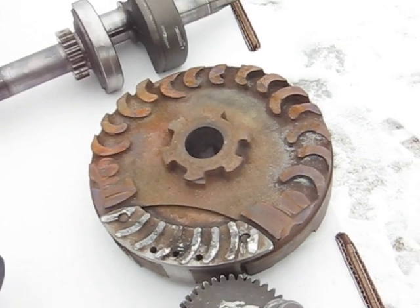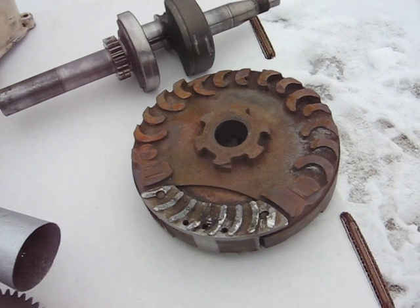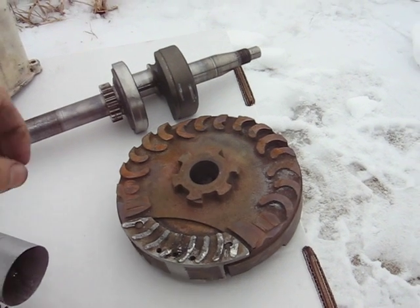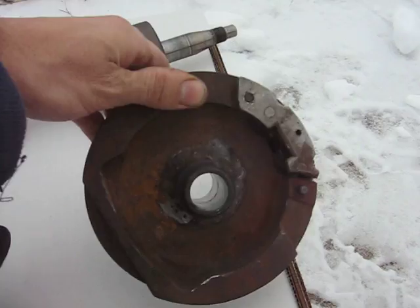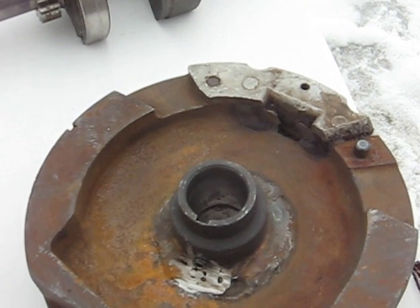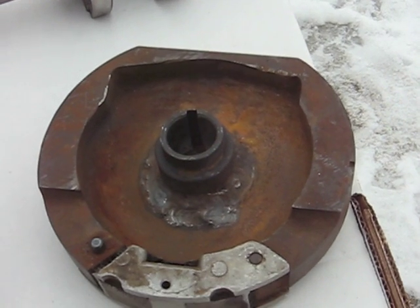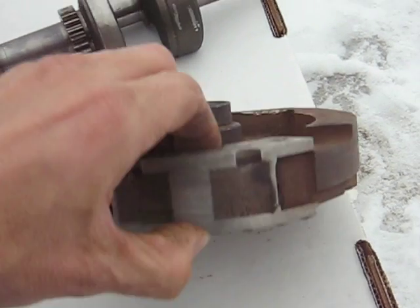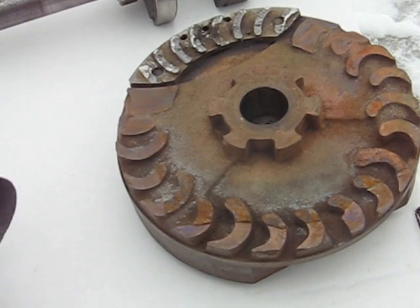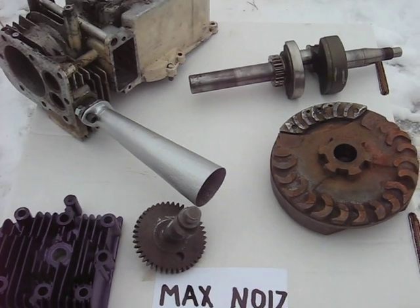The other component we had to modify quite a bit was the flywheel. I'm going to be running the stock flywheel on top of the engine because this is a vertical pull-type starter, and I wanted to keep it that way. So I'm putting a heavy rototiller flywheel on the bottom of the engine. To do that, I had to cut all the fins off it, and my friend at ACDC Welding welded up a collar on it with a keyway to drive it. That proved to be a little more fun than we anticipated due to welding steel to cast iron. I still have to shave it down a little bit lengthwise just due to the crankshaft length making it all fit.